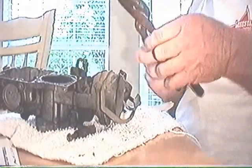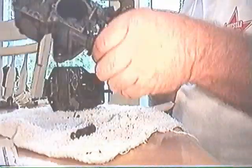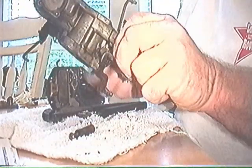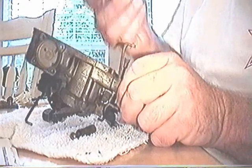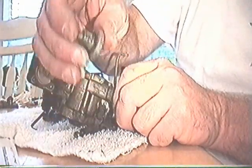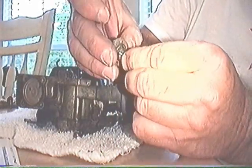It's really a very simple carburetor. It has a power valve, which should come with the rebuild kit. The gasket's still there — I may be able to put this carburetor back together without a carburetor kit, but I may as well get one and do it up nicely so it won't have any problems. This power valve is the most common problem with these carburetors — not having good fuel mileage. If you can get a new one, you're much better off.